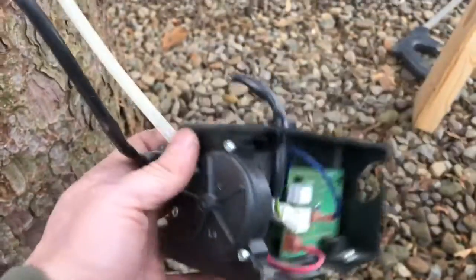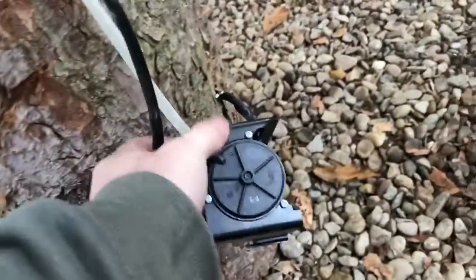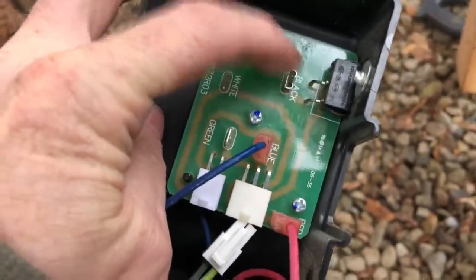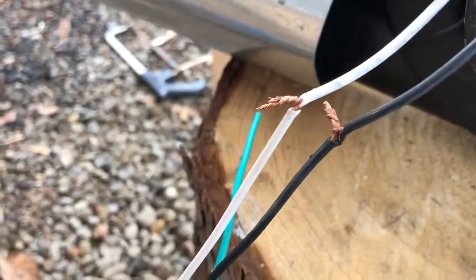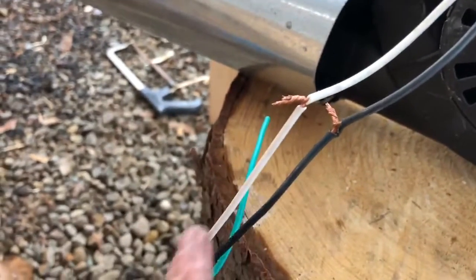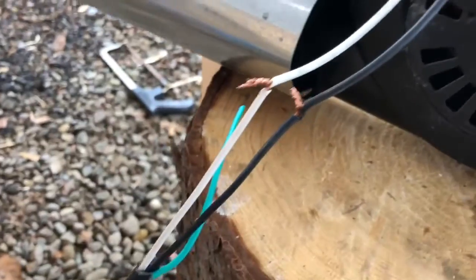I plugged it in — it's all plug and play — and it didn't start, which got me to look at that box here: some kind of indicator or pressure switch, a differential switch. What I did was take the wires off — black, white, and green — and direct connected them straight from the motor. I didn't bring any wire nuts or wiring tools out here so it's a little sketchy, but you get the idea. I should put some kind of interrupter switch here so I don't have to keep going back and plugging and unplugging it. For now we have this: black to black, white to white, regular power.